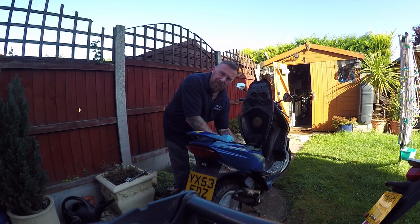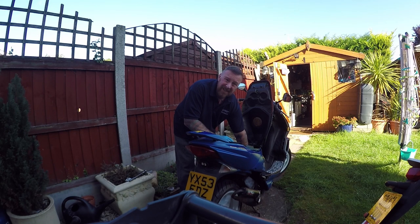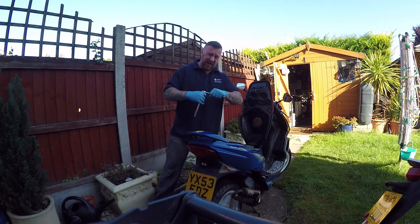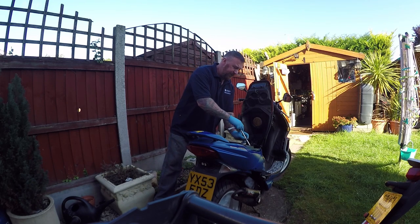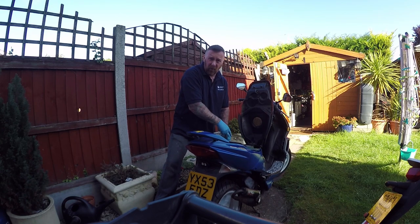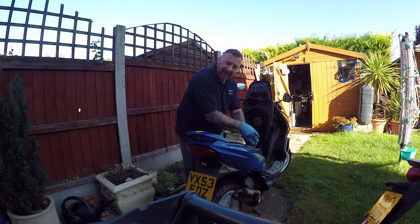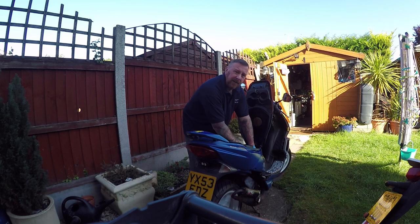I kept looking at the belt that I put on here, and I kept thinking, I've actually put the same belt that it came with back on there again. Now, the rollers worked out 36, which was perfect. However, they were really grainy. So I put in 30 with three rollers and three rollers of four, so 42. I changed the jet, which we know now was an 80, to a 64, which is much, much better. And I popped it all back on again.